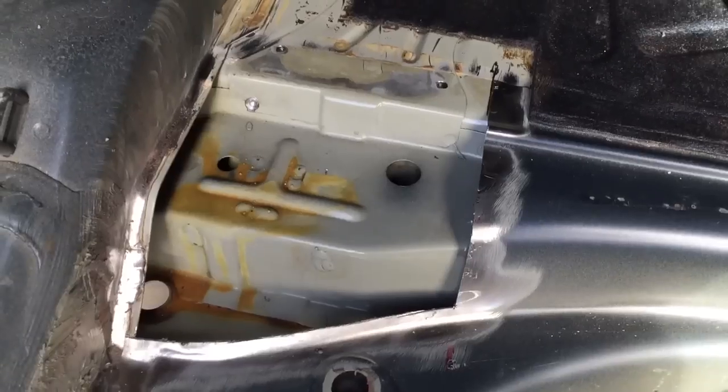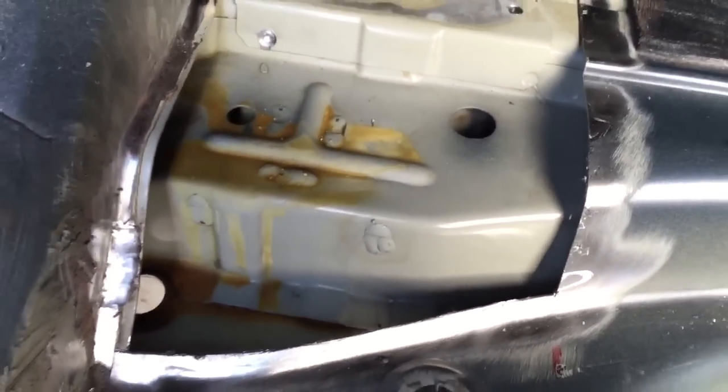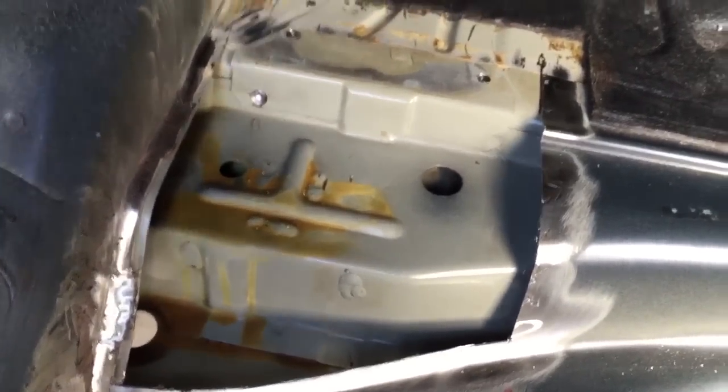And then the issue was this spot weld. I haven't yet cleaned it, but there's a spot weld in there and a crack going up the panel heading for this MIG weld. So that's the one that we've had to cut open this access panel to repair. So clean this corner up a little bit more, and now you can, I say clearly see it, it's still a very tiny crack, but it is definitely there, heading up to that MIG weld, and that's all internal, on the box section of the rear axle carrier panel, inside the cabin, in the boot. That's why we've had to take out that access panel to be able to get to it.